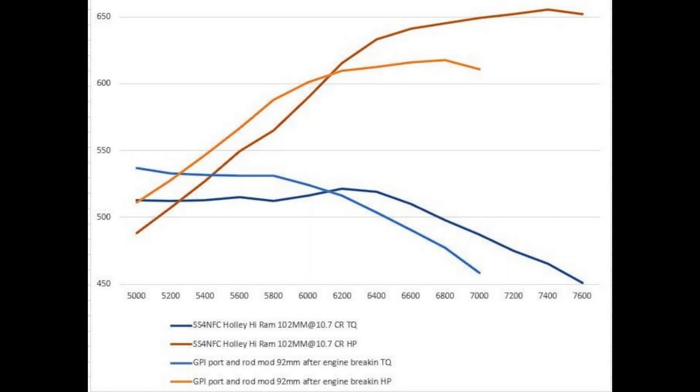However, what a lot of folks do not consider is the RPM range required to take advantage of the gains that the Hi-Ram gives you. Runner length, along with camshaft, has a major influence on the operating RPM range where you're going to make your best power and your highest average power. The factory LS3 manifold has a runner length of about nine and a quarter inches, whereas the Hi-Ram is much shorter at six and a half inches. Given the same camshaft, the Hi-Ram will shift peak power up about 600 RPM. Power in the RPM range ahead of the peak suffers, and power beyond the peak carries out much stronger.